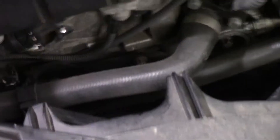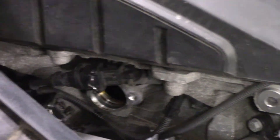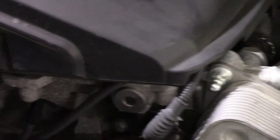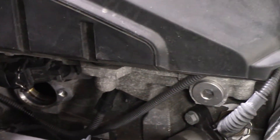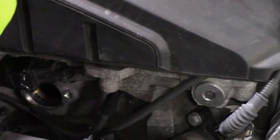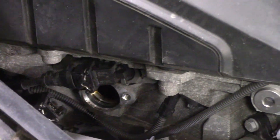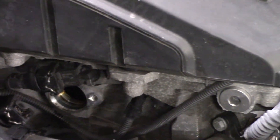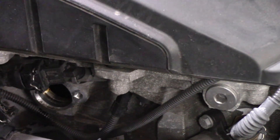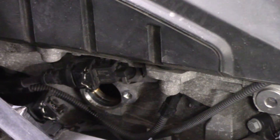We've got the exhaust solenoid out. There's a little bit of oil around it — not much. Just put a towel there. Make sure your O-ring came off with it, as it should stick to the solenoid. Make sure your new one has an O-ring — if you buy the BMW brand it comes with a new O-ring. Slide the new one in. I couldn't find a specified tightening torque, but you definitely don't want to over-tighten into the cylinder head. Just tighten it down so it's good and snug.